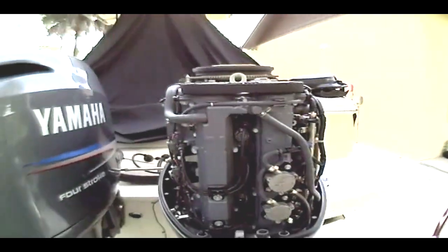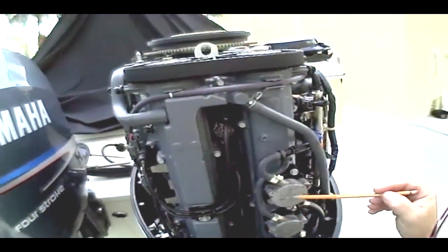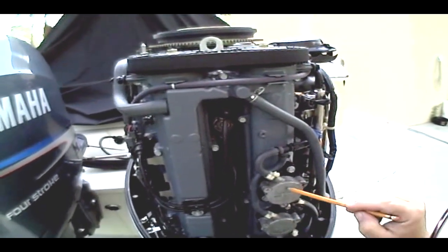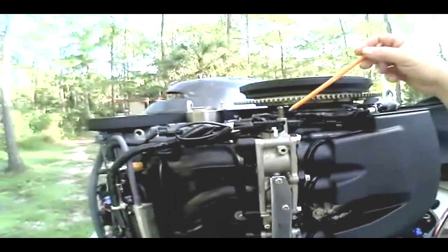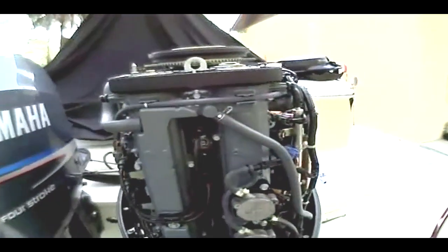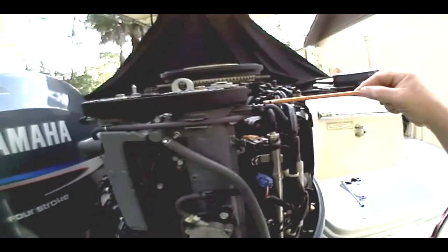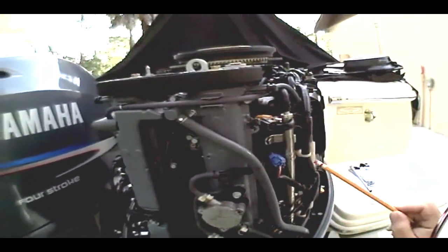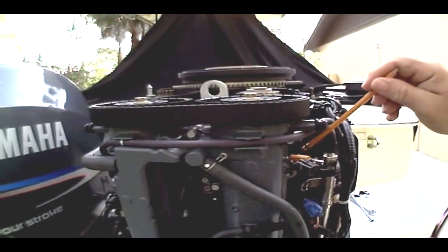Okay, there ain't a whole lot to it. We're looking at the back of the engine, and these are your mechanical fuel pumps right here, which come off your filter in the front — fuel comes in here, pumps fuel mechanically from here all the way around. Inside behind this butterfly unit there's a tank with an electric fuel pump, which supplies the fuel injectors. The fuel injector rail is right here, and this has constant pressure on it from the electric fuel pump, which keeps pressure on these fuel injectors and they fire in the cylinders electrically. Here are our fuel injectors right here.